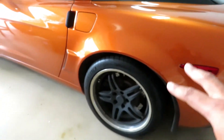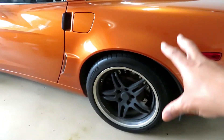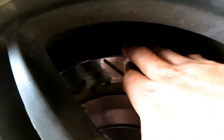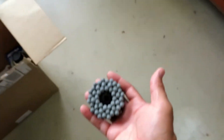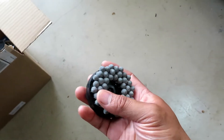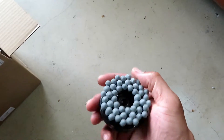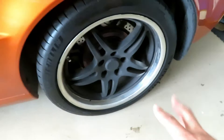However, since I've been using stock OEM-type pads, there's some glazing on the rotors. You probably can't see it, but it's like a highly shiny surface — that's not the way it's supposed to be. There's been glazing from the previous brake pads overheating during my drives. I have this tool here and I'm gonna hone it — not necessarily resurface, but try to get rid of that glazing by putting a bunch of swirl marks on it and breaking it up.